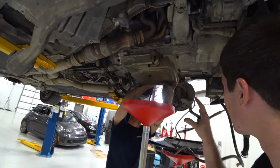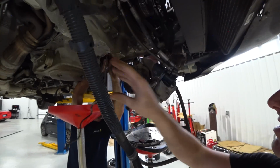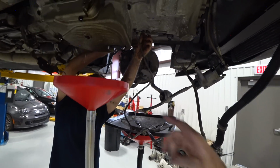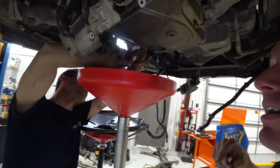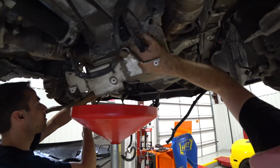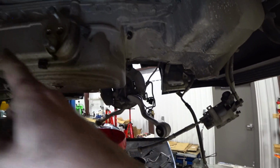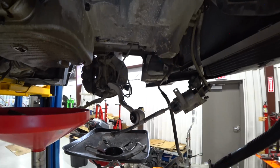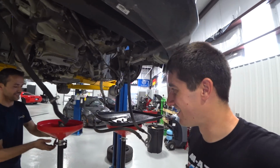We are flying through here. Everything's off. Here's that accumulator. All the wiring harnesses and secondary air stuff and oil pumps are off the pan. Johnny is stripping the wires off the pan right now. And that pretty much leaves us down to these transmission case bolts here on the bell housing. Those come out. And then a million tens and a couple Torx, and it should drop. So the pan will be off very soon. Sooner than I expected, that's for sure. Flying.